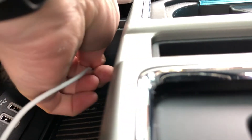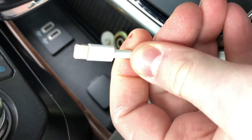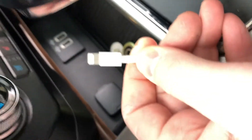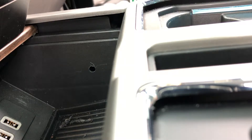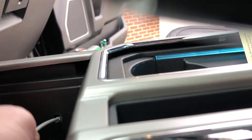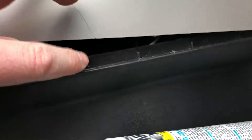So let's see if it fits. We're going to have to go bigger — I couldn't even get the lightning cable portion, the metal portion, through the hole, never mind the cap behind it, whatever you call that sleeve. So we're definitely going to have to put a bigger drill bit on. We went to 5/16ths — let's go ahead and drill it again, make it a little bit bigger. There we go, the magic number is a 5/16ths drill bit.